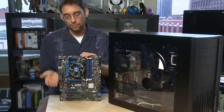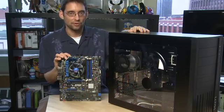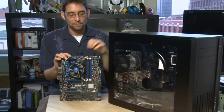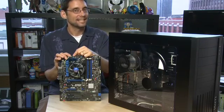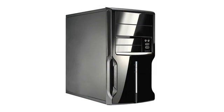You might be able to get a motherboard that's a little bit smaller, known as a micro ATX. In that case, you wouldn't need to have a case that's this big in order to fit it in — you might be able to get away with a smaller case. If you have something that's a full ATX size motherboard, you won't be able to fit it into a case designed for a micro ATX. So it is important to make sure that you match the two up.